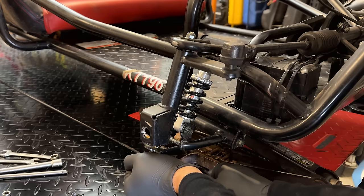So I've got the two cranks side by side, the old one on the left, new one on the right. And visually, they look the same, with the exception that the older crankshaft has the longer output shaft. And given that they're both clones of a GX200, likely they are the same and interchangeable. But let's just double check that the journals are, in fact, the same size. So we'll start with the old crank and try to get a measurement here.